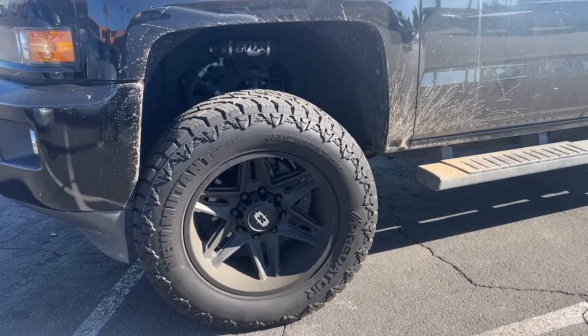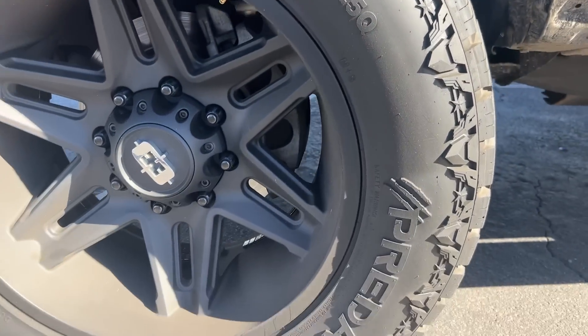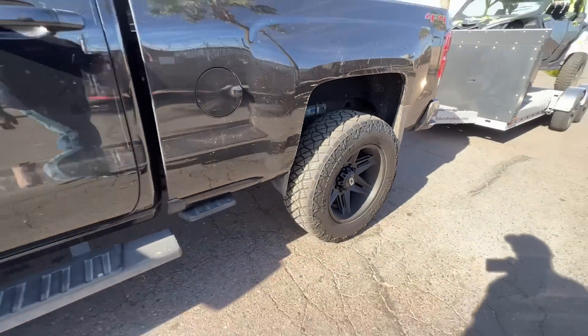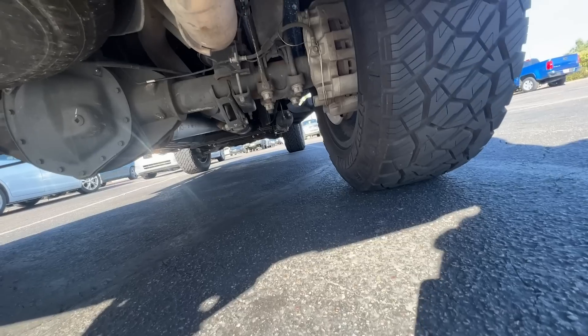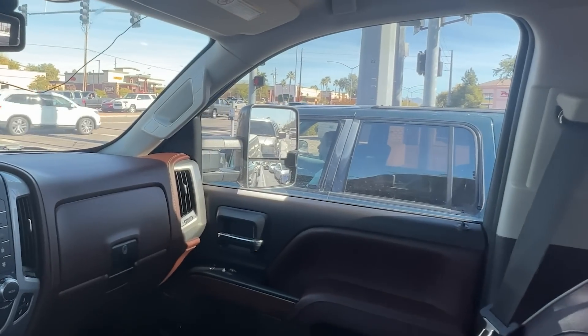I did love the truck, but it was way too big — 12-inch lift, 40-something-inch tires. This is more my speed. I did have to cut the fenders a little to fit 35s; I just like the bigger stance. The tires aren't a well-known name brand, but they have really low highway noise and look good on the tread — kind of an old-man truck. It doesn't have a lift, just a leveling kit. The previous owner removed the torsion bars so it's a coilover up front with an air ride in the back. I've also got air horns on this.